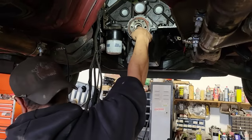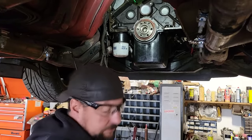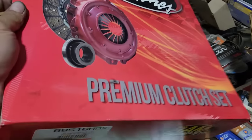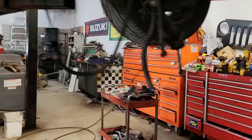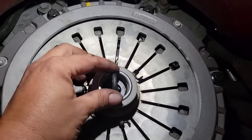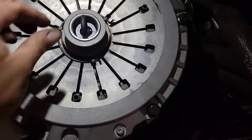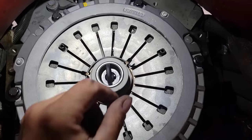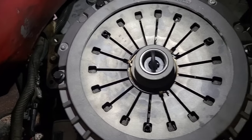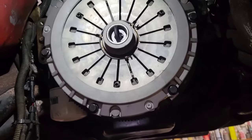We'll pop the new bearing in and pack a little extra grease in the needles just to make sure it's lubricated. He picked up this Ram clutch kit — you got to like the Ram if you can't dodge it, ram it. We're putting the Ram in the Camaro. The new pressure plate and clutch disc are in there, got the alignment tool, and already popped the new pilot bearing in. Now we just got to tighten it up and get it all centered. Make sure we tighten these outer bolts evenly in a criss-cross pattern. Keep sliding the alignment tool in and out as you do it — that way you know when you slide the transmission up, it will actually go in.